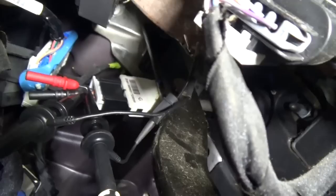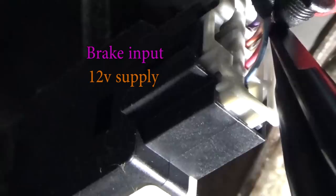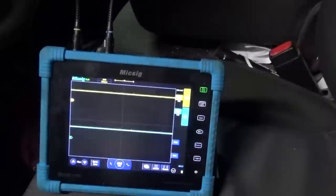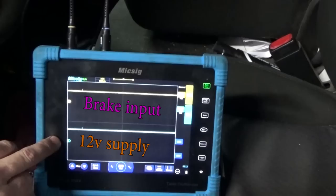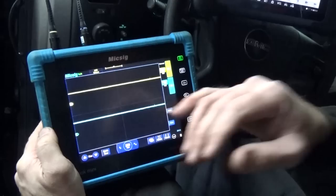Follow your brake pedal up and you will see the brake light switch right there. Top two wires — the top one is purple, and the next one down is orange-and-white. We are backprobing. Trace number one is going to the purple; trace number two is going to the orange-and-white. You can see I have them both on a 10-volt-per-division scale, and we're sitting up around 12 volts.